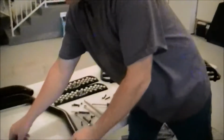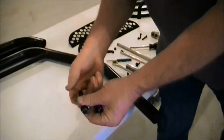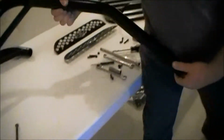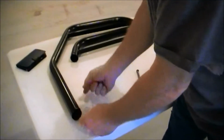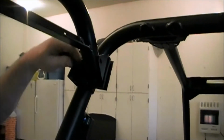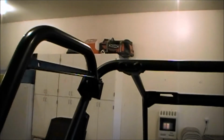Okay, now we'll put the arm on it. You're going to have 2 5/16 bolts, 4 inches long. Black washer on both sides. Make sure you put the passenger side on when you're doing the passenger side, or driver's side, sorry. Angle will go in, left side on driver's side again. I'm just going to start this for ease of doing it. If you have to raise it up a little bit, raise it up. There's plenty of play there to get that bolt started in the bottom.